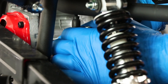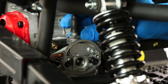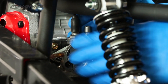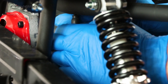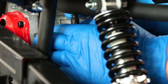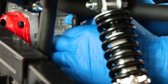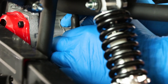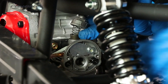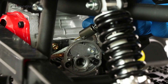Once we've removed the fuel pipe we are then ready to remove the throttle cable from the carb. This unscrews anti-clockwise. It is spring-loaded so once you get it to a certain point it will just pop upwards. Carefully remove the slide out of the carburettor and the needle, and remove away from the carb.